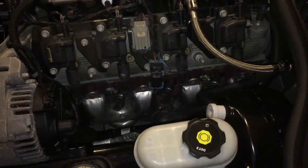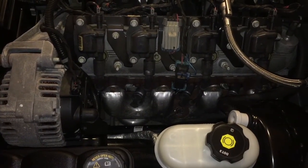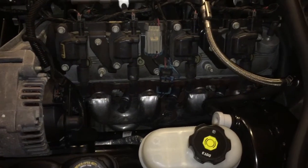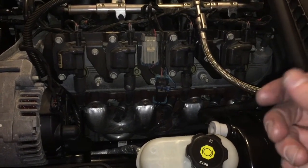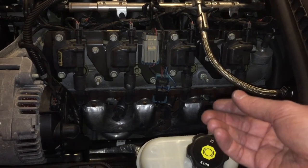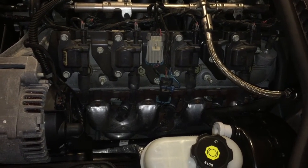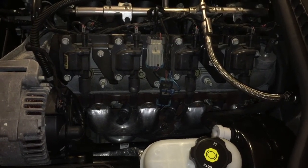All I have to do now is put the fuel rail cover back on the driver side the same way I took it off — it should slide right on. The one thing to caution: when putting the spark plug wires back on, make sure you feel a secure quick connection on both ends to confirm it's seated properly. And that's it — check out my other videos or subscribe to my channel.